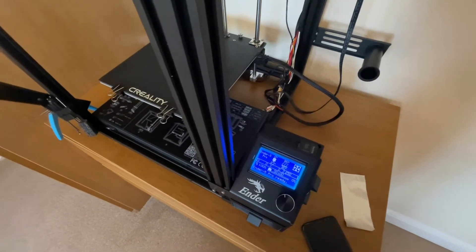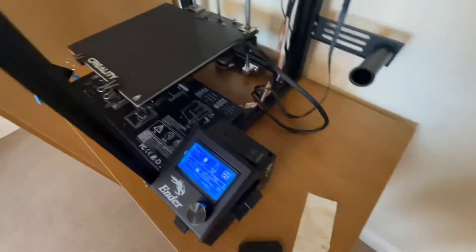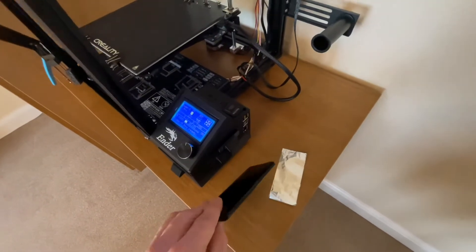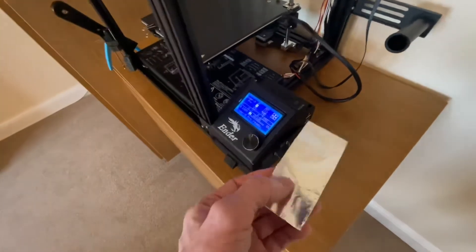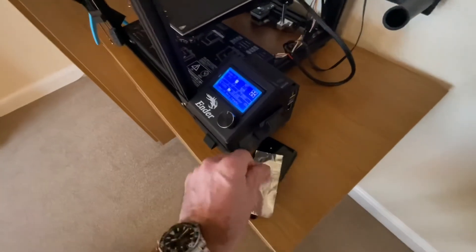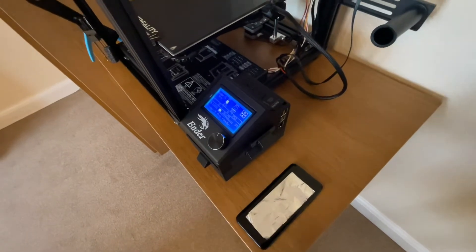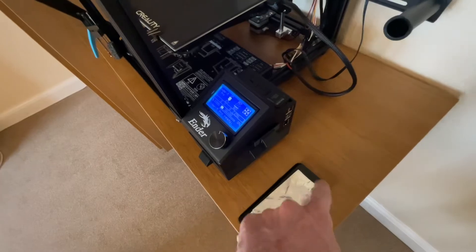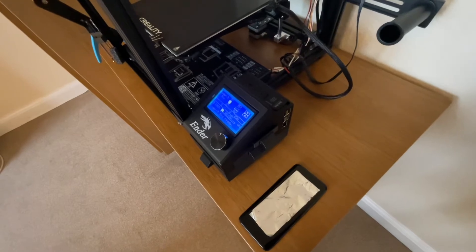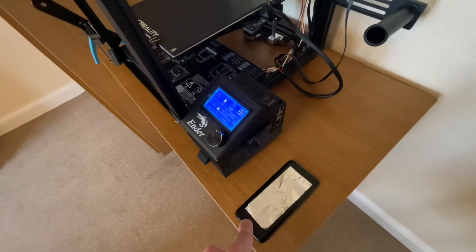I'm not really sure if this is going to work, but the first thing I'm going to try is heating the bed up to 80 degrees — you can see it's already done — and then stick the phone on here and start with a minute to see if that has any effect. I've also got a piece of aluminium foil which I'm going to put in the middle just to protect the camera and the battery so I don't overheat them, and hopefully that will concentrate the heat around the edge to let the glue heat up enough so we can get the cover off.